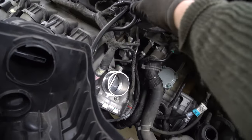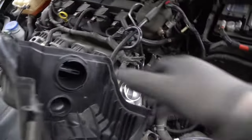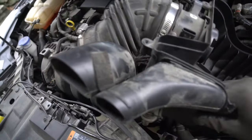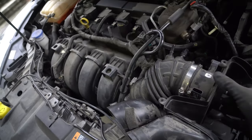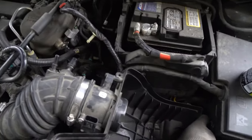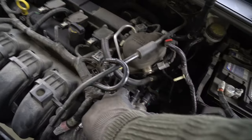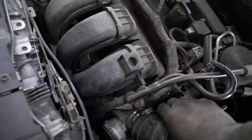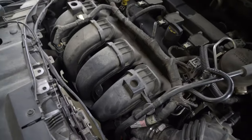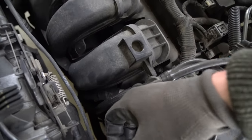Make sure everything's out of your way. Now that we know everything's good to go, bring the air box in on a bit of an angle. Make sure the plastic flap is open, put it in, and suck this back up. A little bit of finagling — you want that to pop back in. This goes back here; put this in that little rubber lever down here.